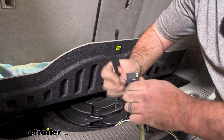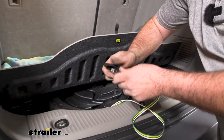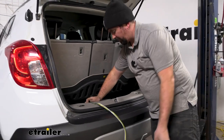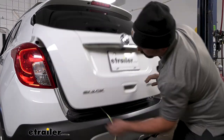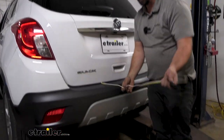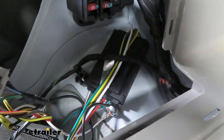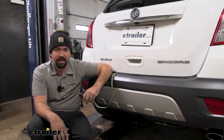When you are ready to use it, it's pretty easy. We have weather stripping along here that gives us enough give to pass our wires through. That way we can just drape this out, make sure it's flat and away from the latch, close it down, hook up to your trailer, and you're ready to go. This is module protected, meaning if you have faulty wiring on your accessory or trailer and it does have back feed, it's going to stop at the module and protect your factory lighting.